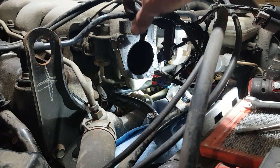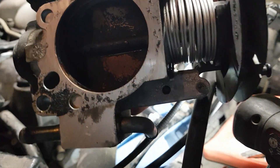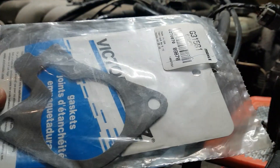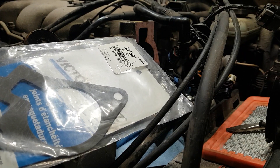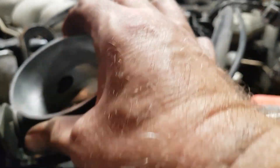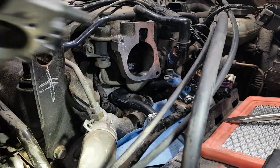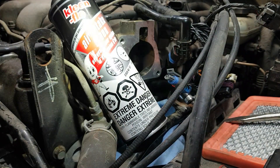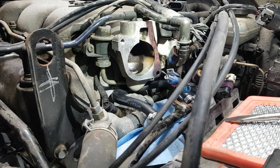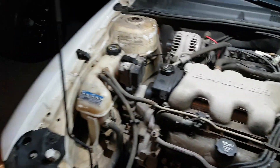Now I'll just scrape this off and put a new gasket on. I got the hoses off and I'm just going to clean up the back of the throttle body, and while it's off I'll clean up the throttle blade as well. I got my gasket here — I got this from RockAuto for about 75 to 89 cents, less than a dollar, on clearance. I bought like 10 of them. Got the throttle body all cleaned up and shined up, ready to go back on. Just use some air intake cleaner, let it soak for a bit, scrub it off — stuff works pretty good. Now we just put it back together, basically the reverse of taking it apart.